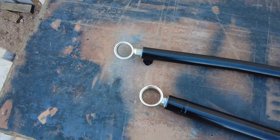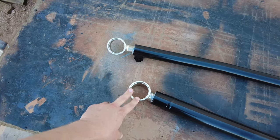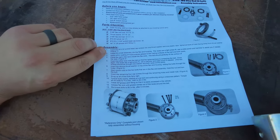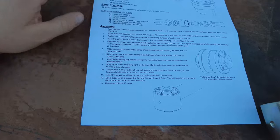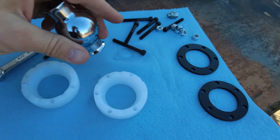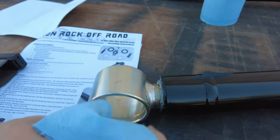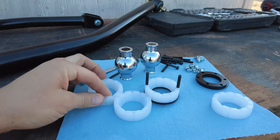After sorting the hardware, it's time to build the flex joints for the three control arms and then adjust them to the length specified in the instructions. The kit came with instructions on how to build the flex ends — one sheet for the lower control arms and one for the upper. The flex ball is polished and looks great. I'm going to wipe off any remaining oil, clean the inside of the control arm to remove dust or dirt, and then apply a light film of grease on the races and the flex ball.